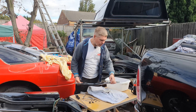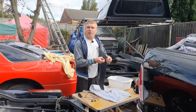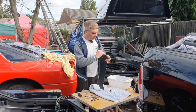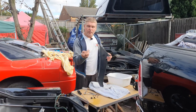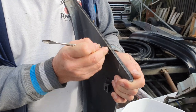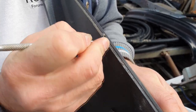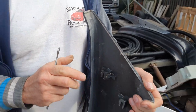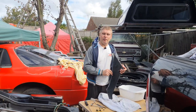If you're not re-spraying the panel, just use a normal bowl of soapy water, a soft sponge, and a toothbrush to clean in all the little cracks and nooks and crannies. When we turn the panel over, when we peeled off the old trim it was stuck on by double-sided foam adhesive tape. That tape sticks really well and you'll find some of it is still left on the panel and some on the plastic trim. To get it off I'm just using the metal dental tool to scrape it off until it's nice and clean, then I'll use a degreaser to remove any remaining residue.